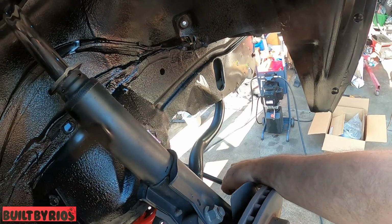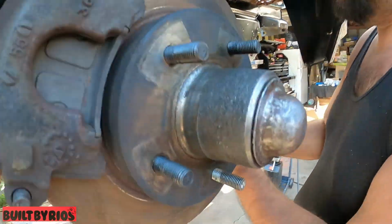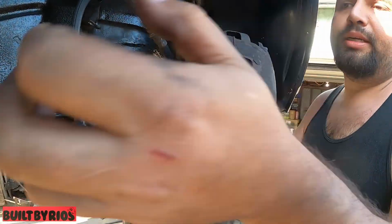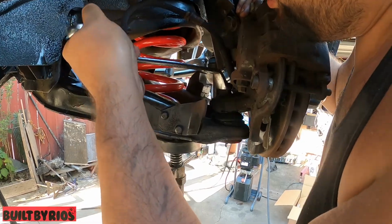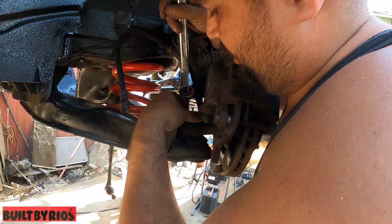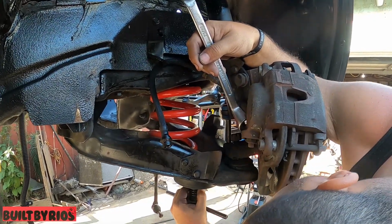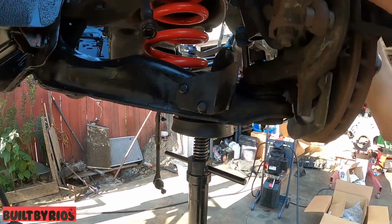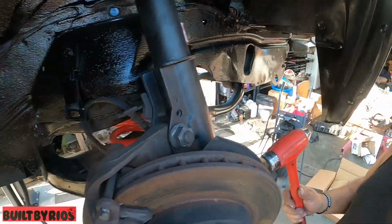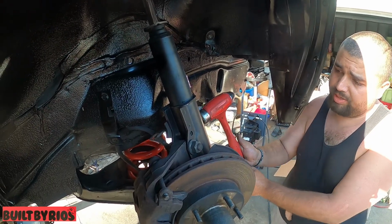Right now we're taking off the tie rod. This way. Let's see. I want to leave enough thread on it. You just want it to pop. You want to not that much. You want to leave a little gap so they can land on it. And here's when you're gonna whack, whack, whack. Four way then. Make sure that nut doesn't screw all the way up, because you're gonna be in trouble when that spring pops.